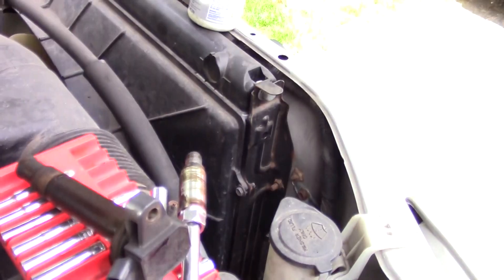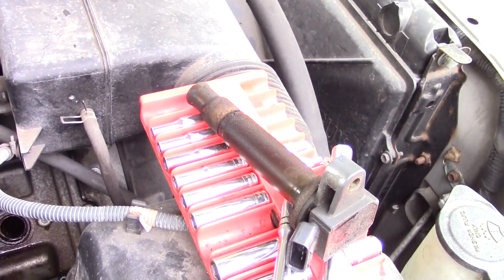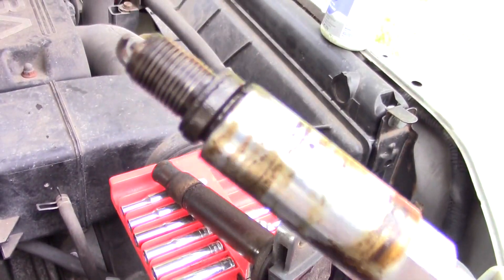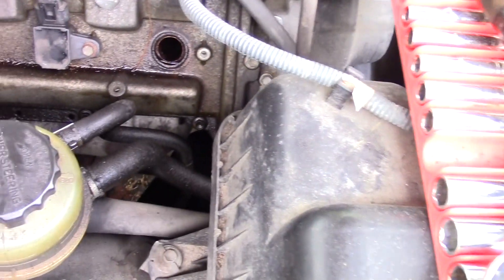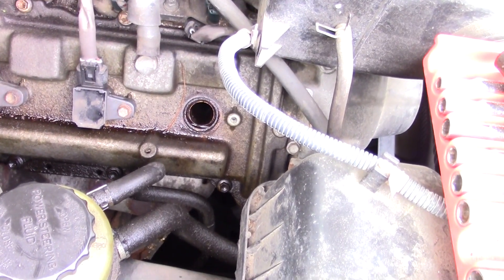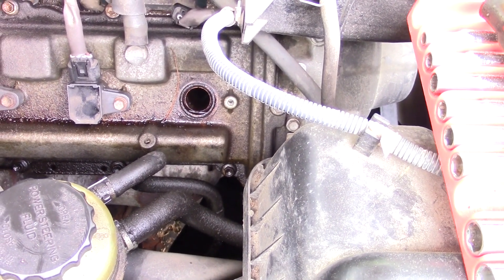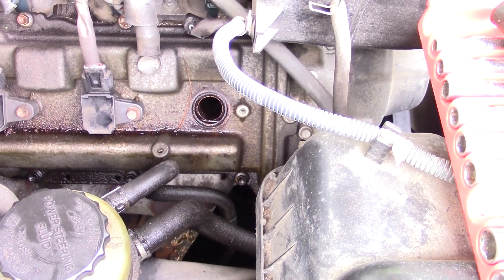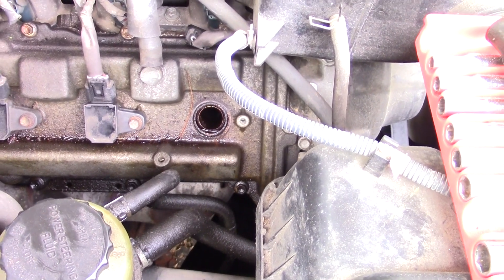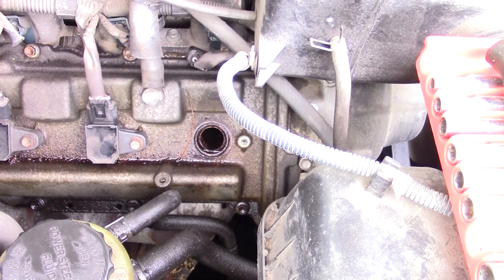What do I do with the plug? The plug is wet. So I'm going to real quick just clean off the plug and the coil, and clean up that oil a little bit — just real quick to see if the miss goes away, which I think it might. And if that's the case, I probably don't even need plugs. It probably just needs a new valve cover gasket.